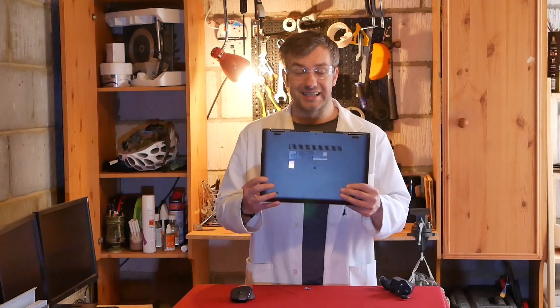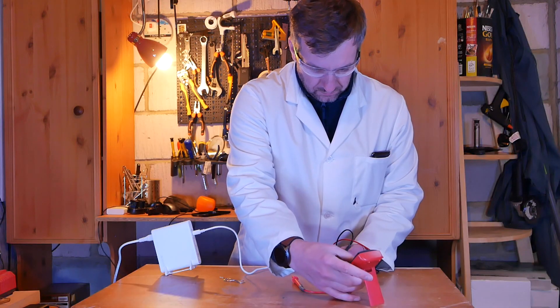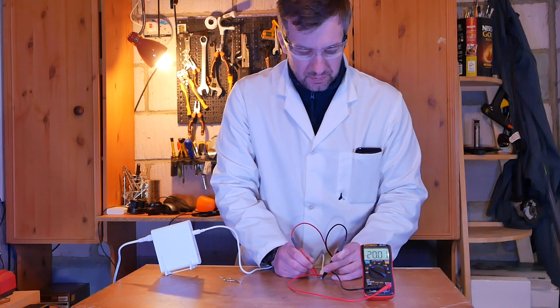First of all, I have to see if I have enough space inside the laptop to accommodate the extra electronics going inside. Second problem: I have to explain to the charger that I need to draw 20 volts out of it to power my laptop. That's not going to figure itself out, so I'm going to use this clever module that has been programmed to do so. As soon as a compatible charger is connected, it will tell the charger that this socket needs to draw 20 volts. Before making any permanent damage, I just wanted to make sure I get 20 volts with this module — and yes, indeed, 20 volts spot on.